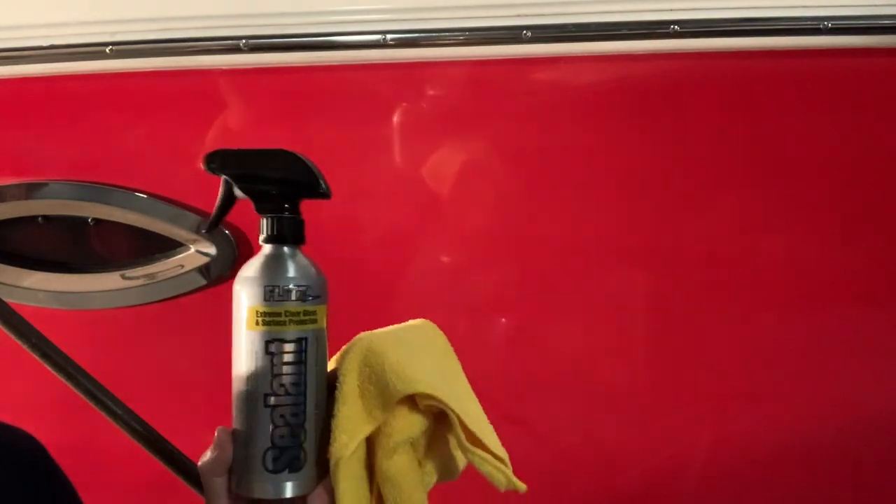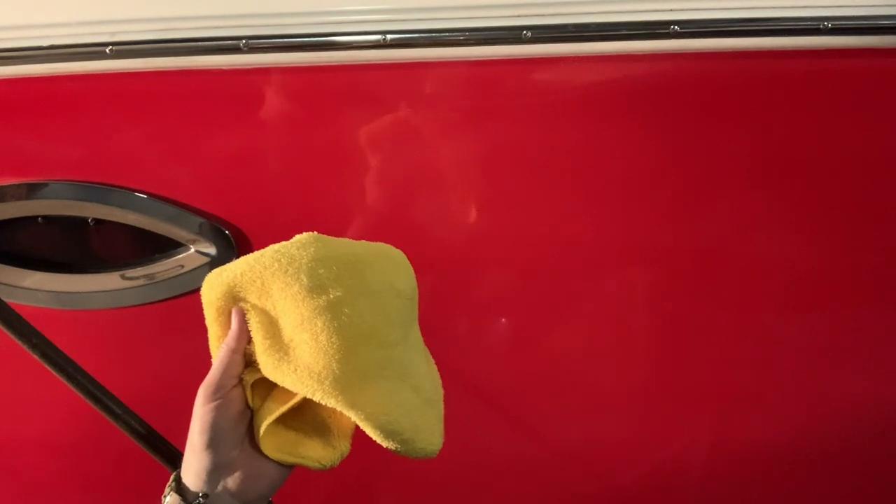This stuff's real easy to use. I do want to thank Frank and Rainey — the guys that sold me the Flitz, gave me a good deal on it. I don't know if you guys watch this channel or not, but thanks, guys. So I've got a microfiber cloth that is damp from sealant. Spray it on, let it drip a little, spread it around with the damp cloth, and then take your dry microfiber and wipe it off. Important to not let it dry. Nice and shiny — and now it's protected. Water will run right off. It's protected from UV rays, oils, fuels, that kind of stuff. Great product.